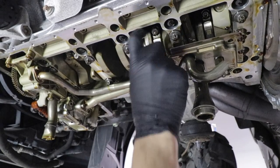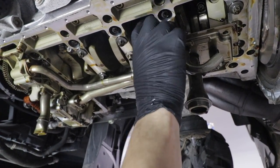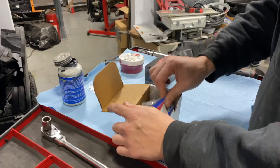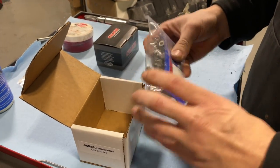The procedure goes: remove the bolts and caps, take the cap off, inspect the bearing, push the rod up, take the other bearing off, clean the crank, install new bearings, install new bolts, and slide it all together. We've got ARP hardware.